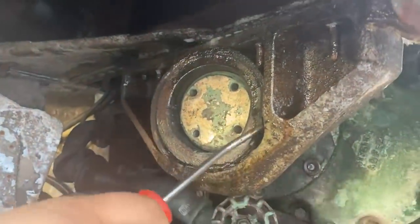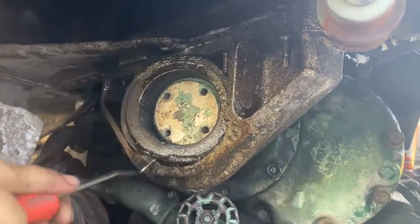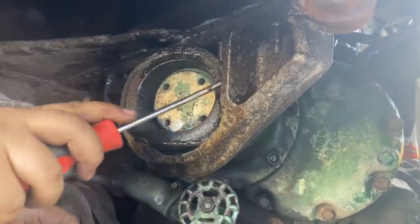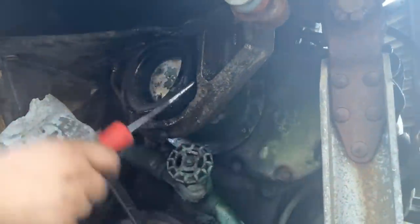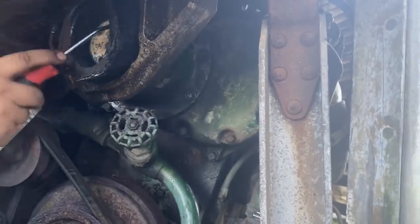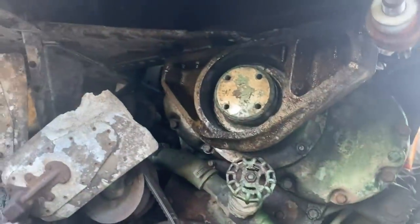Pulling the motor mount out of the trunnion, hoping that we have the engine pretty neutral balanced in there right now. We got jacks under it. It's coming out pretty good. Don't let your finger get pinched if the thing comes down. Sorry. That looks tight. At least it's tight at the top, not at the bottom. So we've got it raised up a little too high. We did pretty good. That engine just wiggled in there and that didn't touch it at all. Yep, we're good.